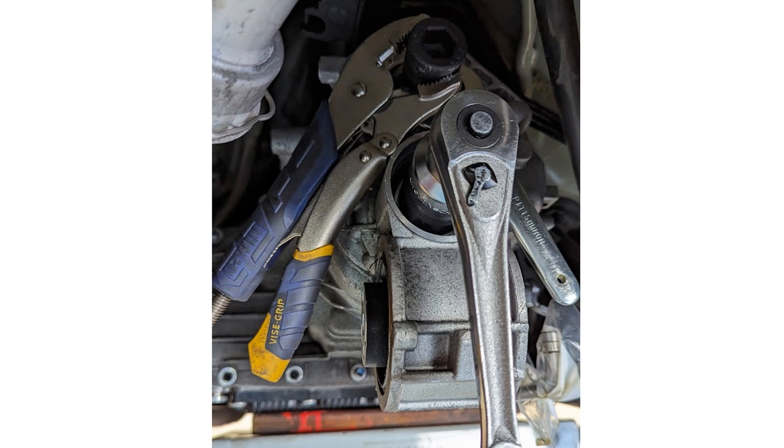Installation of the rear casing is identical to what I showed in the 981 video using the M24 or M22 bolts. For the lower of the two shafts, because of the protrusion that comes out of the bottom of this transmission, you'll need a bolt that's at least 100 millimeters long so you can get it in there and do the job.